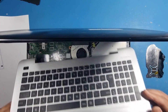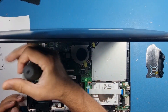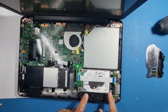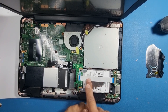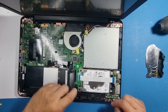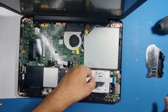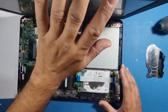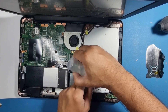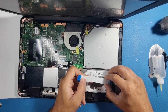While I'm here I've got this little pump — I'm going to give it a quick clean. There's not much dust in it to be fair. The hard drive is located just here. You've got to remove this flex — one says IO board and the other one is for the HDD board, which is that one there. Open the door, pull the flex out. If it's stuck down and too tough, get a hairdryer or a bit of alcohol on one of the sides and it'll come away dead easy.